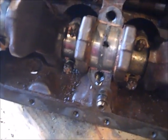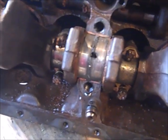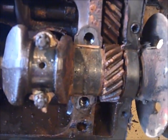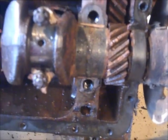Got the main bearings off. They sure are yucky looking. If I get the pistons out and get them moving up and down — the crankshaft looks like I'm going to have to get a big roll of emery cloth and take some shims out of the bearings. It might be all right.